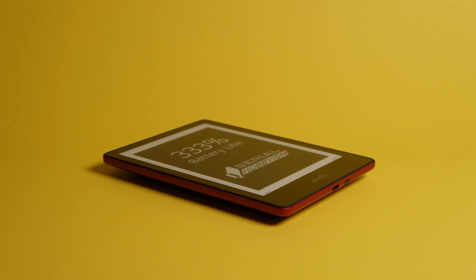Let me show you my design. The new battery is 5,000 milliamp hours compared to 1,500 milliamp hours for the standard battery. That is far too large to fit in the original enclosure, so I designed a new back. It makes the device thicker than normal and the cases on the market won't fit. I don't put a case on my Kindle Paperwhite for protection, but rather to make it easier to hold. Without a case, that gets very uncomfortable. With the case, I can sort of put the flap between my fingers and that lets me hold it comfortably for several hours, even while laying on my side in bed at night.